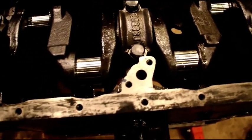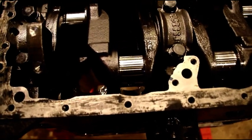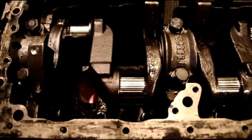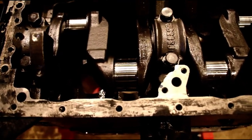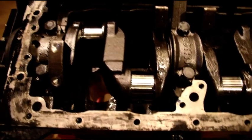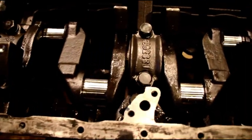Same thing in the back — there's a very large gap there, and we're tight against the thrust bearing in the front. I do not like the main bearing saddles in the Chinese block. I don't believe this engine could have had good oil pressure when it was running. The valves themselves are worn incredibly — the guides are 30 thousandths bigger than they should be. There is a terrible amount of wear in this engine.